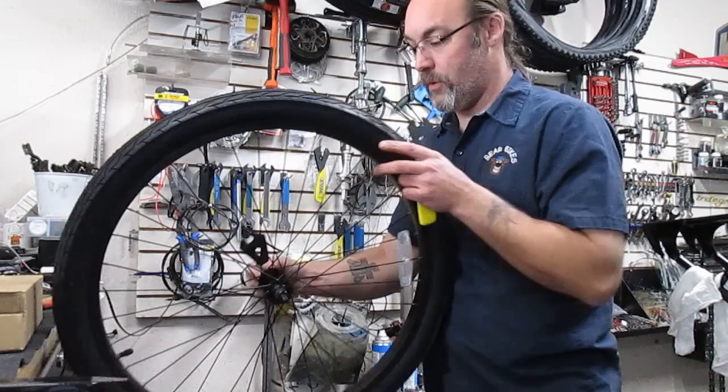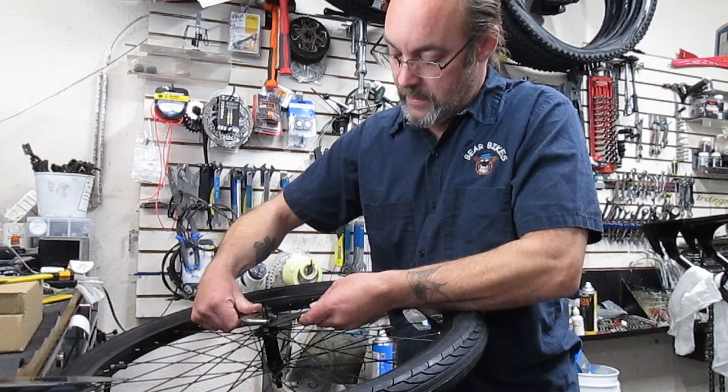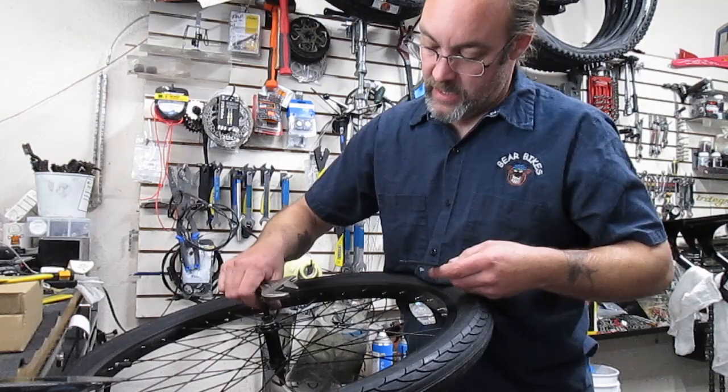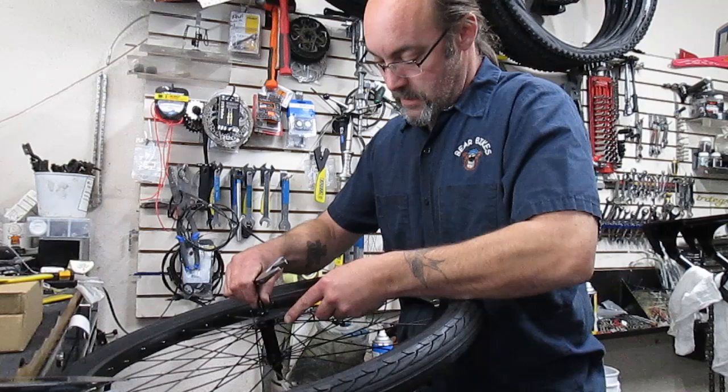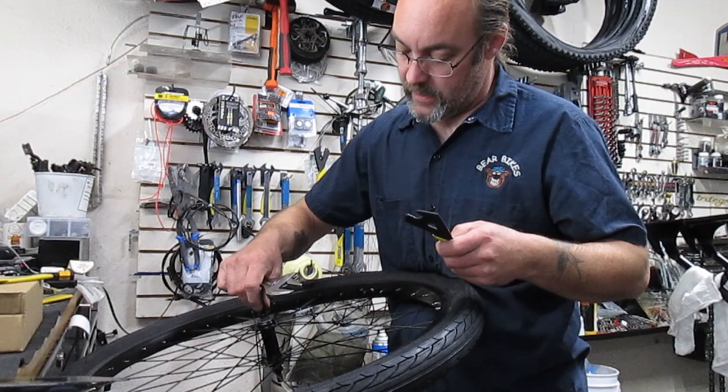Okay, now that I've got that in place, and I know that the lock nut's tight against the cone, I'm gonna go ahead and grab the cone, lock nut. I'm gonna make sure that those are locked together. This side was pretty good. Still feels really good. I'm gonna flip it over, put that on there. Remember, always the bottom one, just hold it. Use the top to do that. And see, that was not too bad. Oh, but now it's like perfectly smooth.